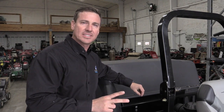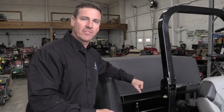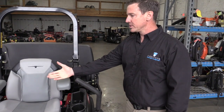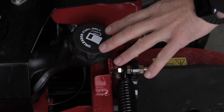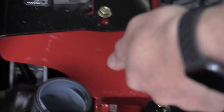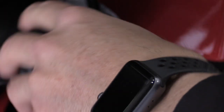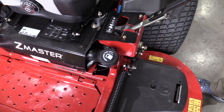Be sure to make sure the engine oil is between the add and the full mark. You want to check the oil twice a day — once in the morning for the pre-trip and once at the end of the day before you put the mower up — when the engine is turned off and cooled. Always make sure your mower is full of fuel. When you need to re-add fuel, go to the unleaded fuel cap. This mower takes straight unleaded fuel only, 87 octane. Unscrew it, fill the spout, and reinstall the cap fully secured.